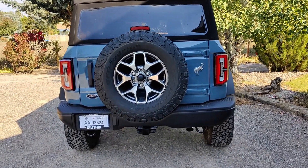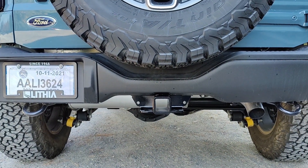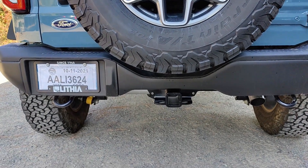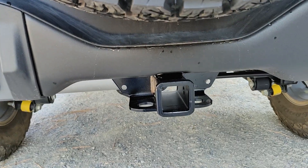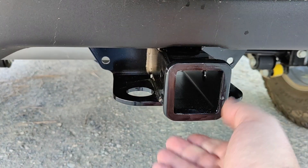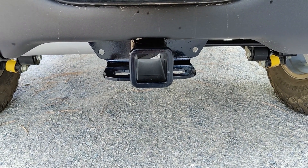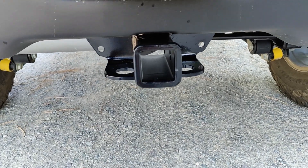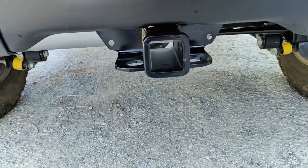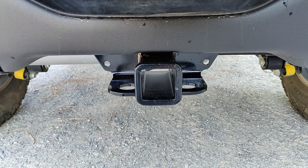Now let's take a look from the back with the job completed. We've got our receiver hitch mounted down here and it looks really, really good. One of the things receiver hitches do when you're off-roading is that if you hit an obstacle on the back end coming up through rocks, the receiver hitch can be your last line of defense to support the vehicle — helping you drag over rock without damaging your bumper or your tow strap connections. $111, guys — I'll put a link in the description box below.